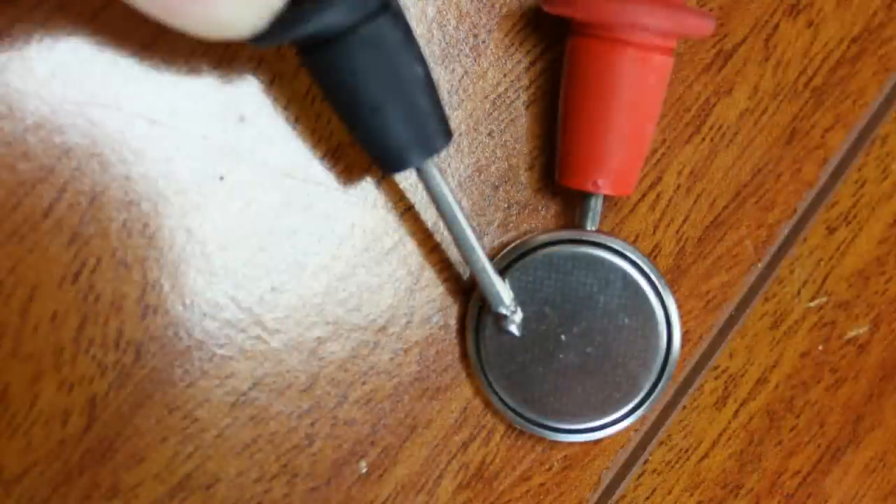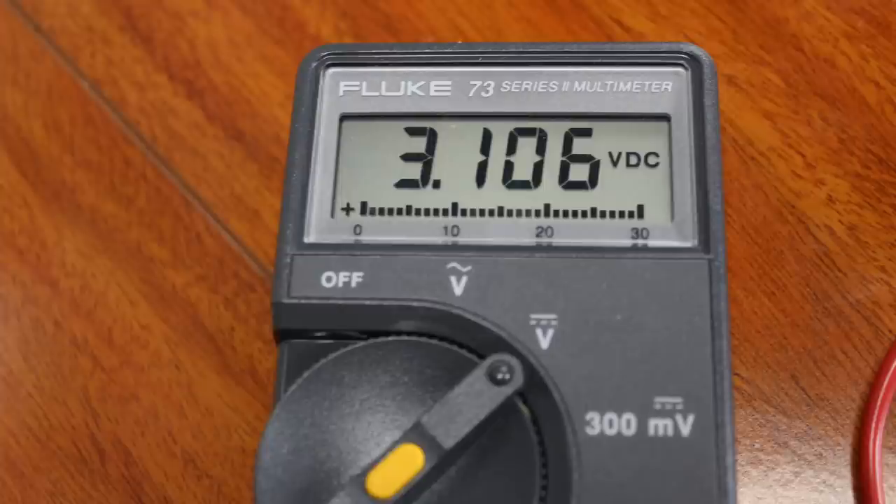Let me quickly show you how to check your battery, since that's the most common failure. All you need is a multimeter. Take the red lead, put it on the positive side, the black lead on the negative side, and measure your voltage — it needs to be over three volts. The newer ones actually need to be over 3.06 volts for the remote to function properly. Once voltage drops below three volts, weird things happen: sometimes it'll lock, sometimes it won't, sometimes the alarm goes off. I've seen cars come back to the dealership multiple times for weird issues because the battery wasn't checked. On the newer all-in-one remotes or Kessie systems, a low battery can actually make the car not start. So start with the battery — or just put a new one in, they're not that expensive.